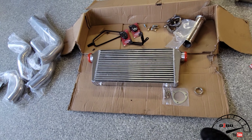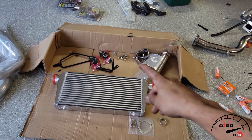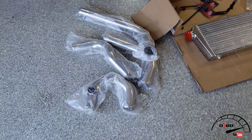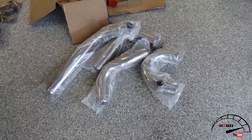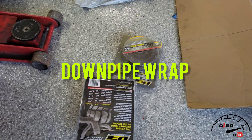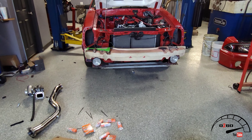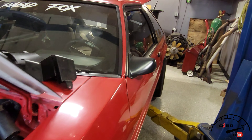Here is the intercooler and another pipe and some clamps. You guys can see the exhaust hangers there, intercooler piping with the welded-in flanges already for the blow-off valve. And there's some header wrap — turbo manifold wrap — so we can keep the heat inside the manifold, get the turbo to spool extra fast. Go ahead and walk around to the inside of the car a little bit.